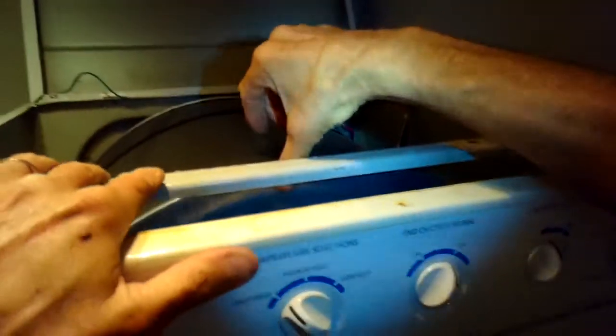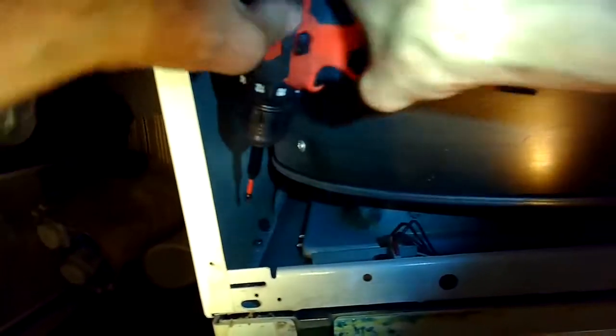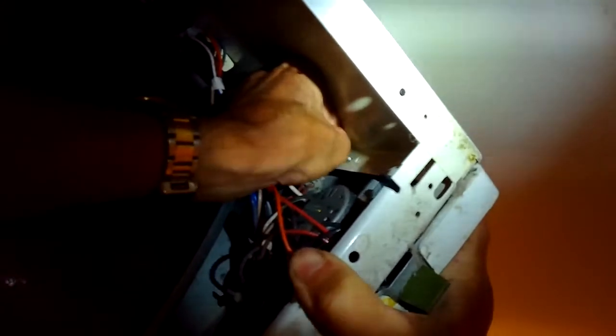Go ahead and put the front panel back on — I put it on the bottom first and hinge it in. I'm going to lift up on the tumbler a little bit so it can sit on the felt front bearing, which is part of the front panel. I'll push the front panel in until it clicks, then add those screws back in. There's a small Phillips head screw holding in the left side of the front panel — get that in with finger tension and tighten it up. Do the same thing on the right side — just take your time, it's a little awkward position.